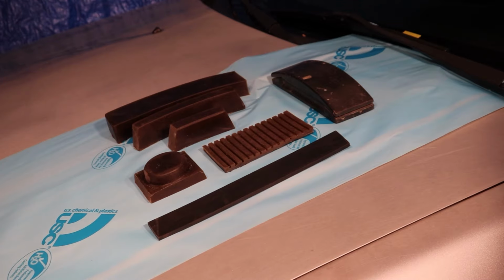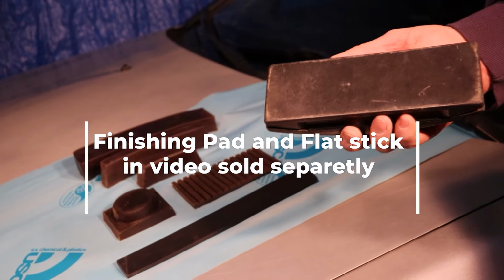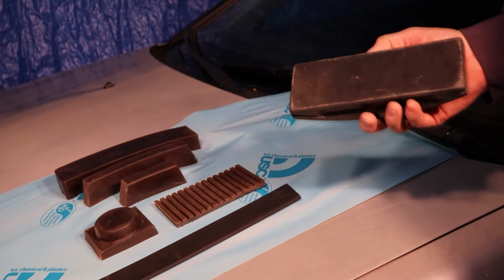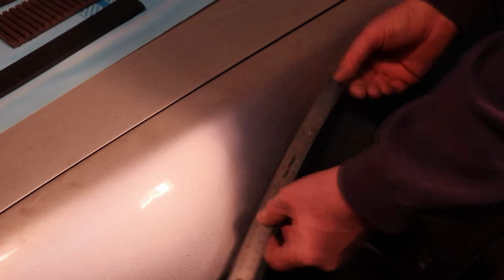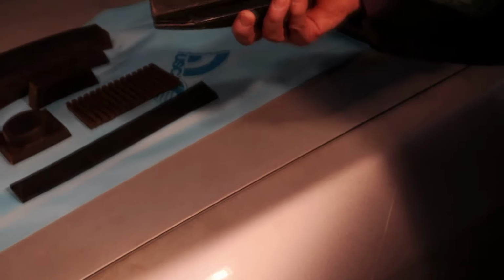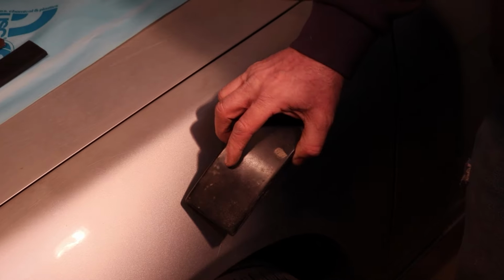Cars used to be very flat, and of course the blocks that were out there had flat bottoms and they are not very flexible, and this is where the problem comes in now. You're trying to work a curved surface, and a surface that's probably going to be curved in two directions. You can watch that ruler rock back and forth and you'll get the same rock this way.